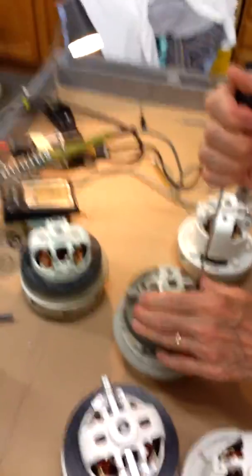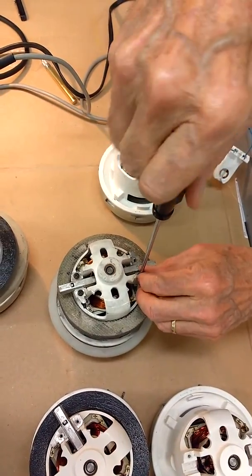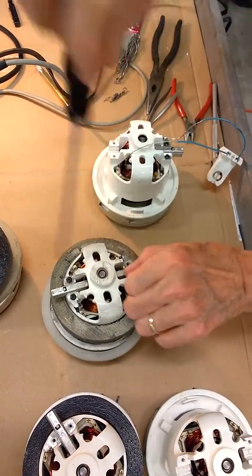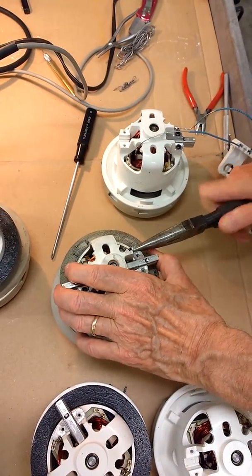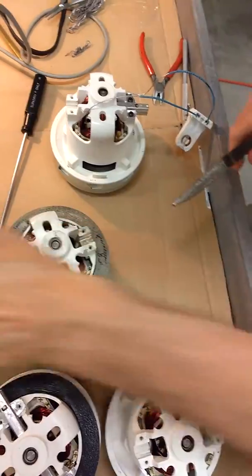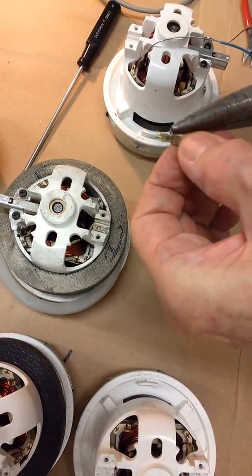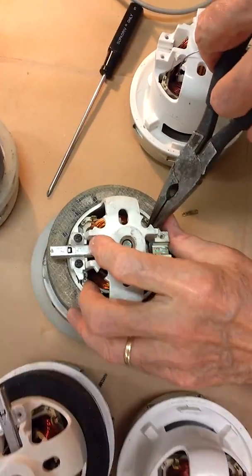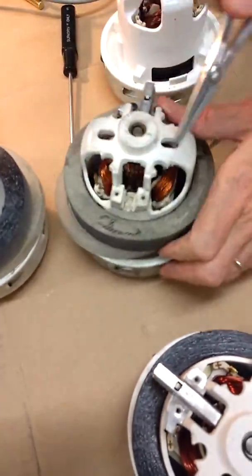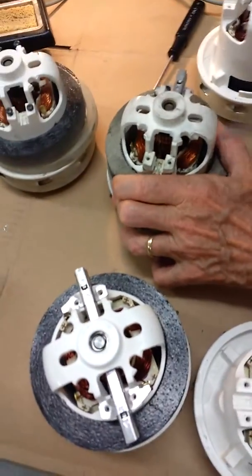So what you do is take these two screws out, and then take the brush out — you kind of just take it off. Look at that — it's worn out, so this one has run a while. This one isn't so bad; they got some use out of it. Anyway, you get down here and work this out. You can see it used to hold a wire, but it fatigued out. So the wire broke.